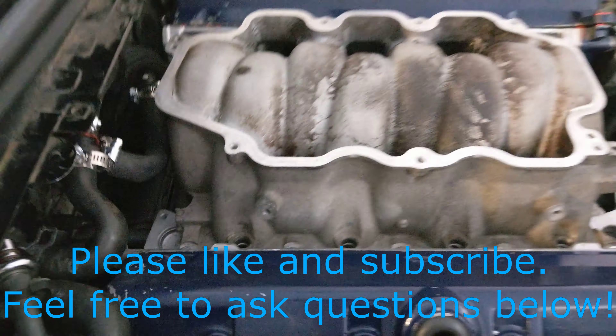The T connects to your other head over there and that coolant comes across, T's up, and goes down into your line that goes through to your water pump. So it's pretty close to stock — you just T in another one and cut this one a little shorter so it pulls coolant from both sides.